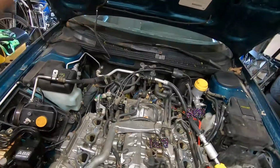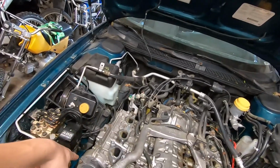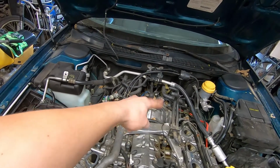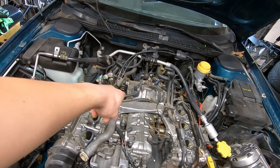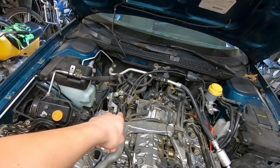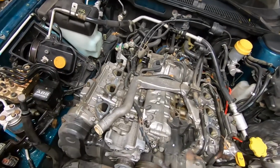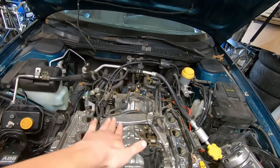Anyway, today I'll be working still on top of the engine. I just need to get those wires off, and get the starter off, get the clutch cable off, get the speed noodle off, and disconnect my shifter, drop the subframe, the transmission crossmember, I should say. I'm going to put some tape over these intake holes because I've risked it enough. I'm going to check to see if anything fell in there. But overall, yeah. Oh yeah, and heater core lines. And this engine should just shoehorn out.